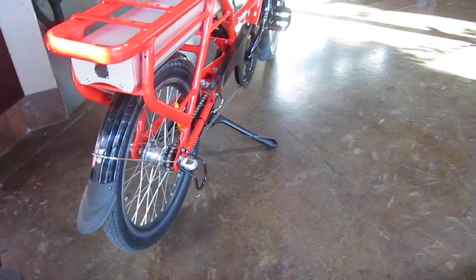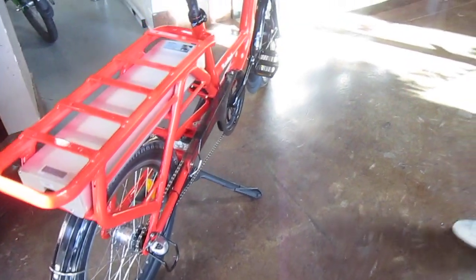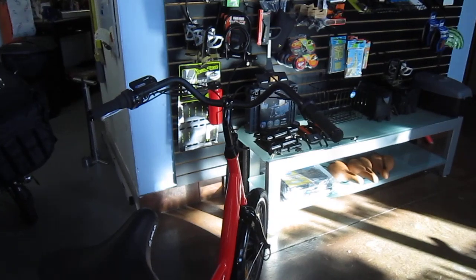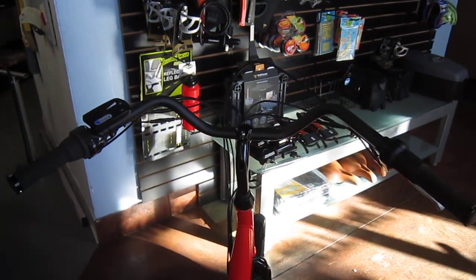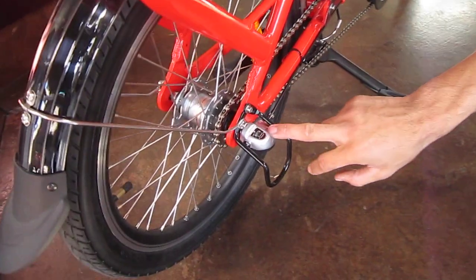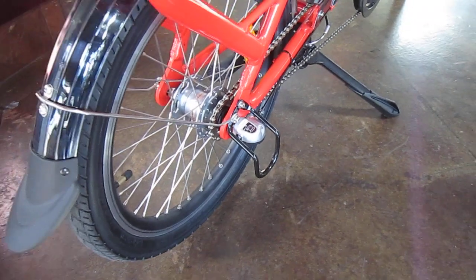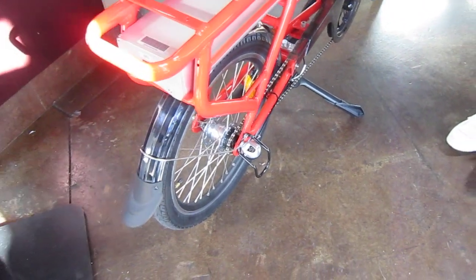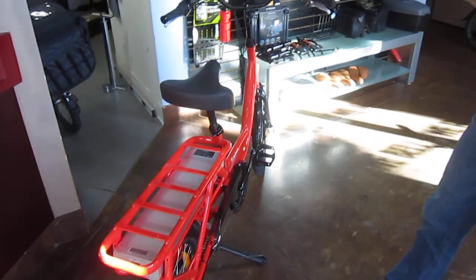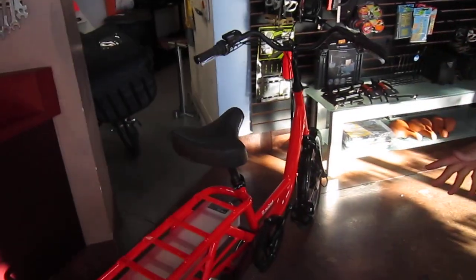You did some changes on the rear gearing on this bike too, right? With the first bike, it was a rear motor bike, and the rear motor is okay, but the problem is you can't use a really high quality internal shifting system. So now we have a Shimano three-speed, which can shift — see, this bike is shifting without even moving into three speeds. When you go to a stop and you're stuck in a high gear, you can still shift down to low gear. That's very important when you're riding a cargo bike.